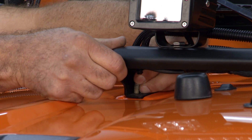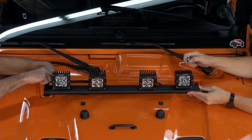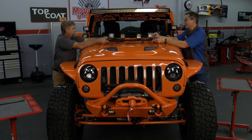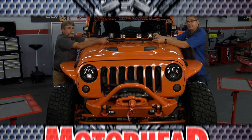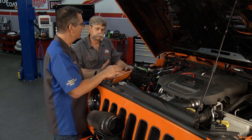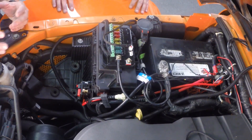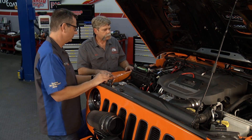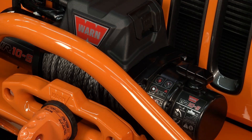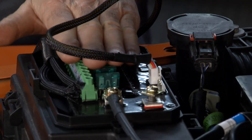We're going back and re-securing it to the hood. After we get this tightened down, all we've got to do is go underneath the hood. When we popped the hood, we found a nasty surprise that the switch box here can handle. If you look over here on the positive battery cable, you can see everything's tied into that — not a good way to do it. Massive voltage drops and corrosion are going to happen. Mike's box is a better way to go. All these lights and other accessories can be moved off that post and brought over neatly to this box on matched breakers, cleaning up all this wiring.